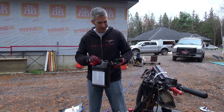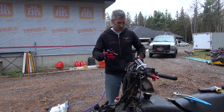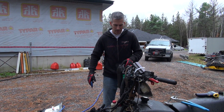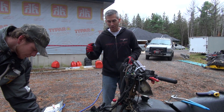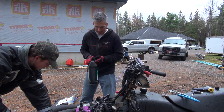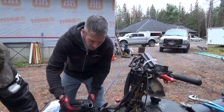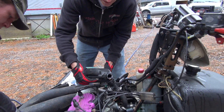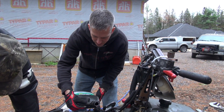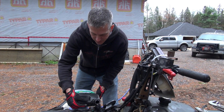We had a lot of people questioning the testing of this Evans coolant that we did last time. I thought the gauge wasn't working, but actually when it gets over 100 degrees it just goes down to double digits — it's an older gauge, so that should be accurate. It's plumbed right into the system. We basically just threw the old head gasket in and slammed everything back together, so hopefully all that holds. The coolant goes right into the motor and right back out — basically a continuous loop, no cooler on this at all.